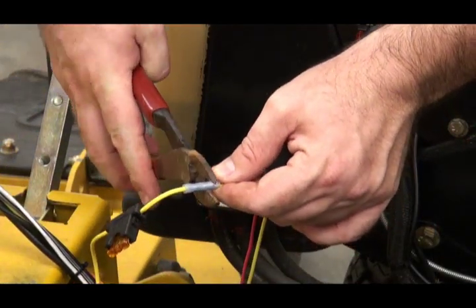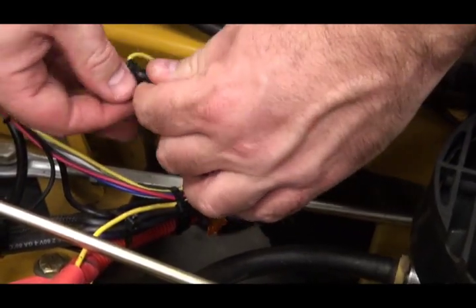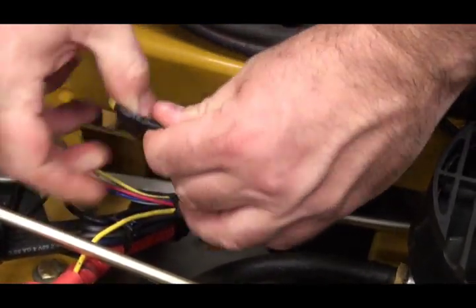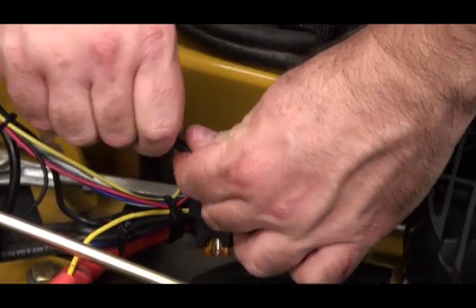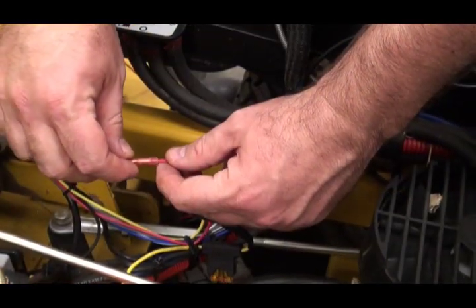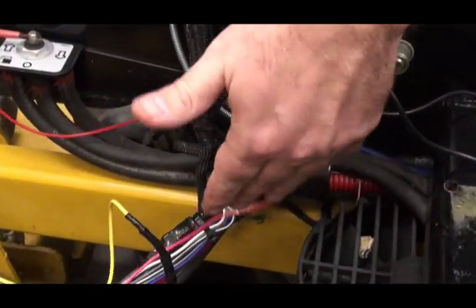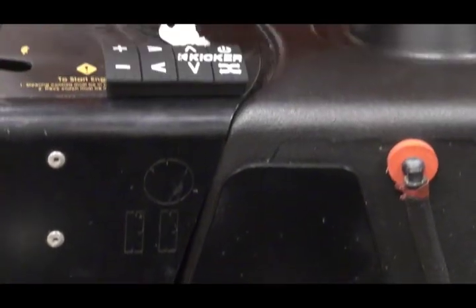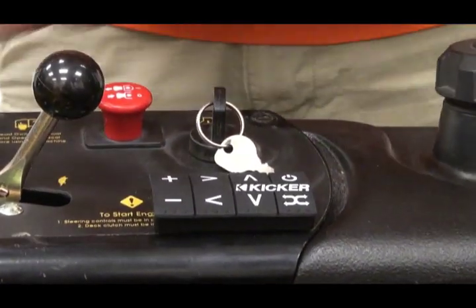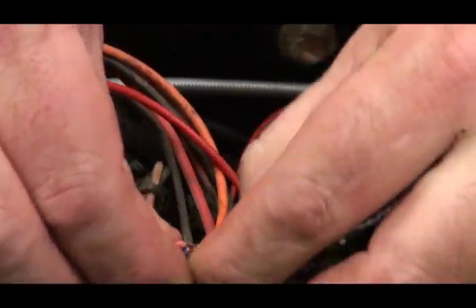This is a very important step — you do want to put a fuse in between the battery and your power wires. We're connecting some 18-gauge primary wire to the 12-volt turn-on lead for the PXI 502 so we can extend it up behind this panel and connect it to the key on the lawnmower.